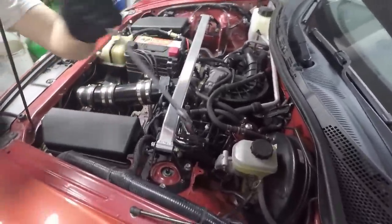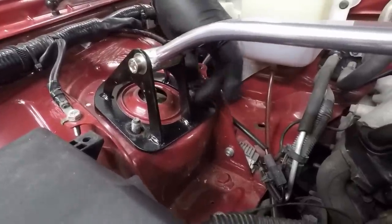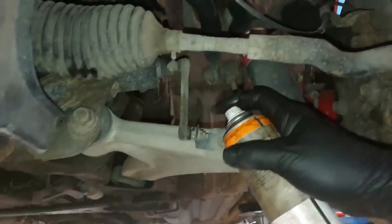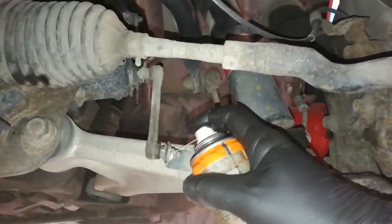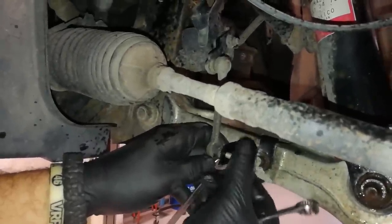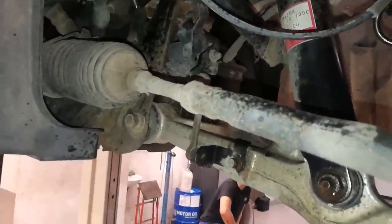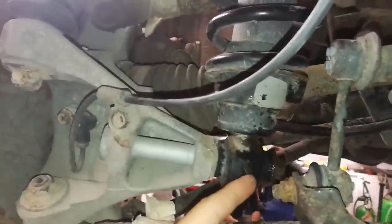In the front, remove the bolts holding your strut bar in place, and if you have the stock setup, remove the three nuts holding the strut brace. When done, take out the strut bar so that the bolts are nice and free. Now it's time to use some WD-40 or equivalent on the lower bolt of the headlight leveling arm and both sides of the lower coilover bolt. With that done, take two wrenches, release the lower bolt on the leveling arm and take it out. This way we won't risk damaging it during the installation. When out, bolt it back on the arm so you won't lose it.